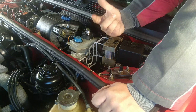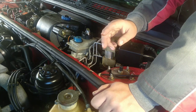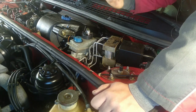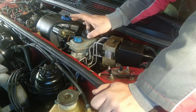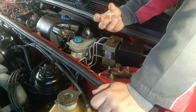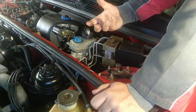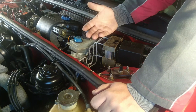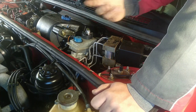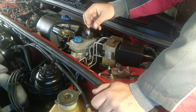The other question is: how did the air get there in the first place? If you don't replace your brake fluid every two years or 40,000 kilometers — and those are maximum values — this fluid is hygroscopic: it absorbs humidity from the air just by sitting there. As you brake, the fluid gets hot, and as it gets hot, it boils the water inside the fluid — and that boiling produces air. That is how air gets into your brake system.